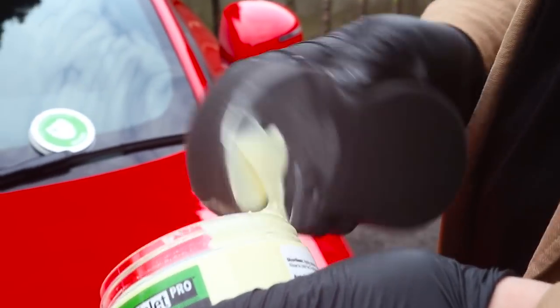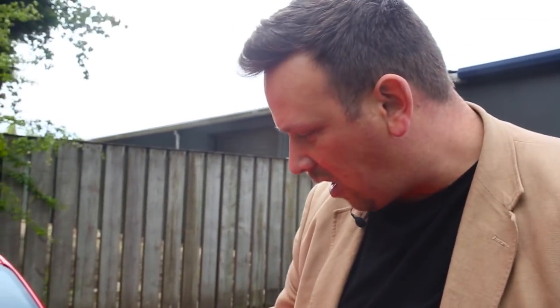If I over-apply it on the paintwork, people look at that as a way to apply wax. The difference between the two is that you can see a slight smear this side, and this side it's quite thick. Because it's thick, it won't cure off quickly. The idea is that you're only applying a micro-thin film of wax to the car surface.